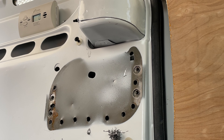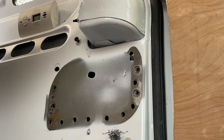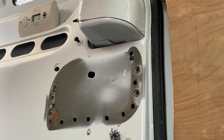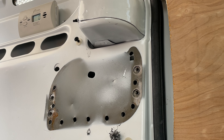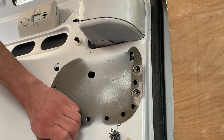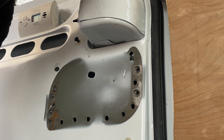Now that I have it off, you can see there's some bare metal underneath and it's a little rusty. So I'm going to sand that down, hit it with some rust-converting primer, and paint over it with some high-gloss enamel. This piece is going to be underneath the cabinet when my build is done, so I don't really care how it looks. I have a bunch of magnets on the outside and some on the inside to try to catch all the metal filings, and I also stuffed a rag in the body panel.